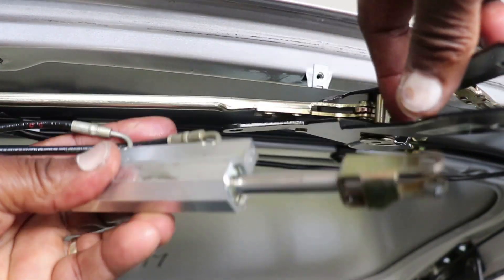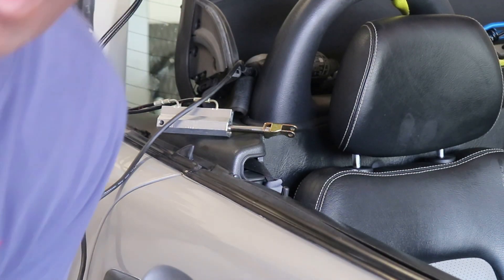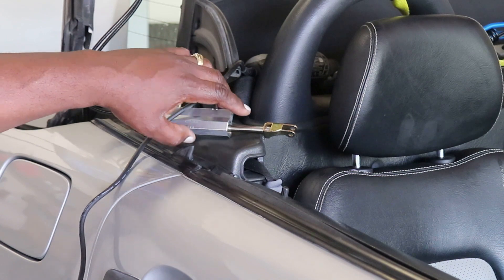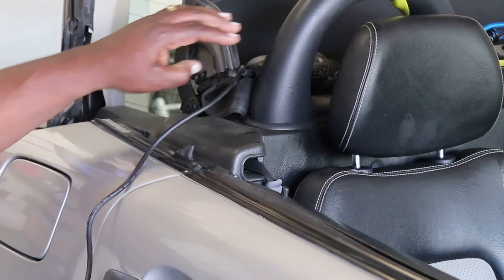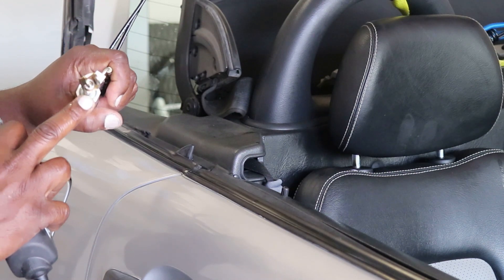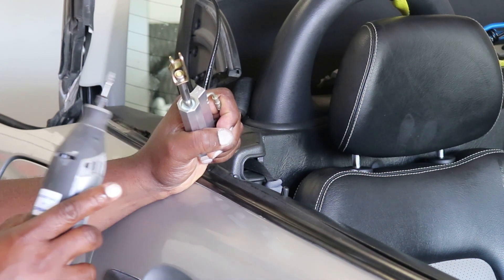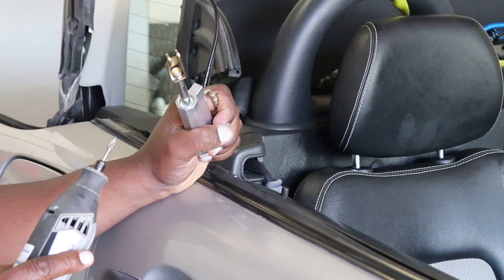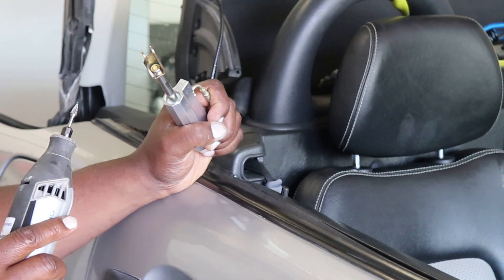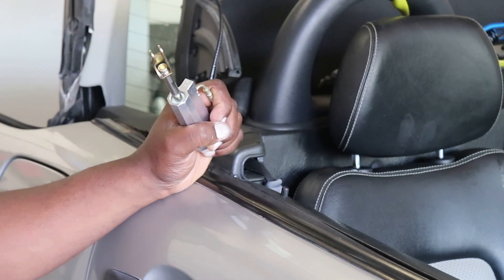The cylinder is now free. Here's the part of this job I like least — not because it's difficult, but because it's kind of a Frankenstein: you have to hack the car a bit. Move the ring out of the way, then use the Dremel right in the middle and cut all the way down to the groove where the ring is — about one-eighth inch wide — then slide the ring around that opening to pop it out.